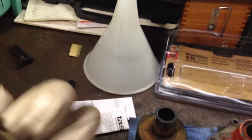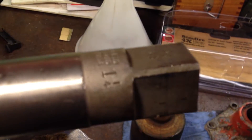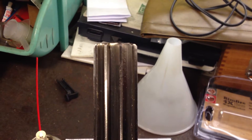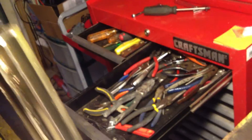I used an inch and a quarter reamer — this big guy here, borrowed it off a friend, inch and a quarter. The reamer itself does have a slight taper at the beginning, which makes it a lot easier to get the job done. Once it is reamed, I just reamed it by hand, popped it in the vise, and off we went.